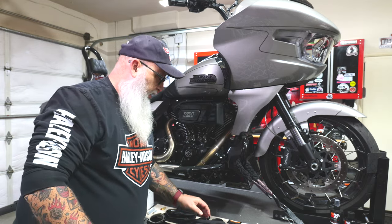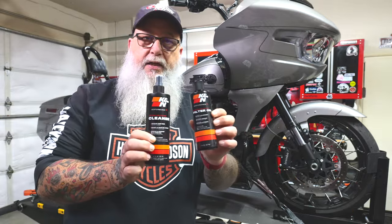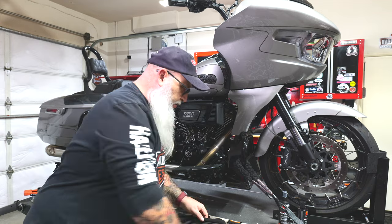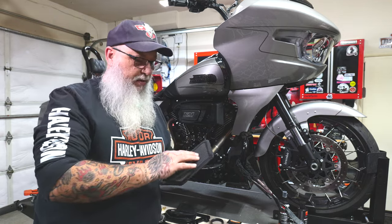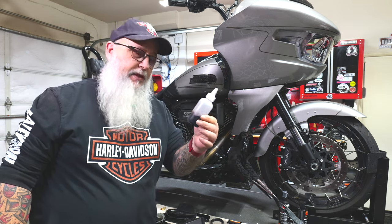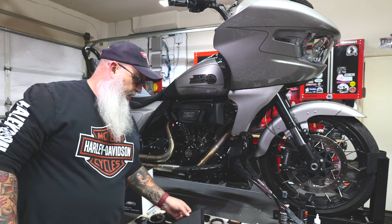The red is cool — big fan of red — but I thought the black would look better on this bike. So I got the K&N filter cleaner and black oil. One of the challenges when you go to recharge this is the bottle that came with it made a big mess — a lot of excess oil, hard to regulate. To overcome that, I purchased these little squeeze bottles from Amazon, about seven bucks for a pack of three. You control the amount of oil that comes out with the little adjuster, and it works pretty good.